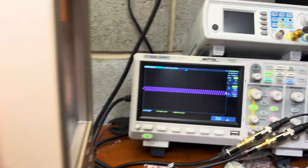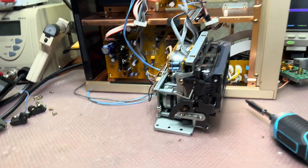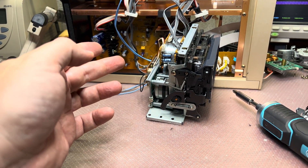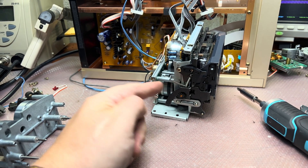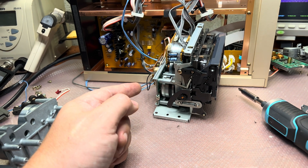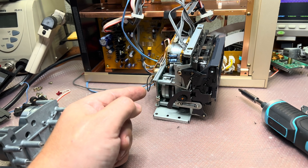We're now technically at speed: 2,990 to 2,992 Hz — that's what all Sony decks should give. I replaced the base with bearings and the capstan on this transport, and I also had to replace the board because it had a different rotation frequency. The diameter difference was too large; when I just replaced the board earlier it was running about 300 Hz higher.